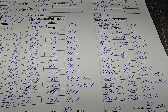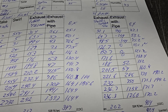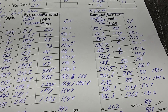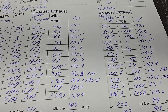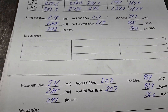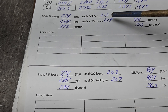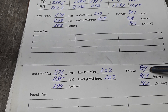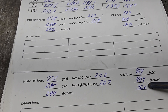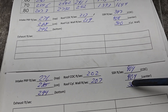The swirl here is actually a bit lower than I'd like to see it. Not much I can do about it — that's the intake as the intake. That intake is flowing at 287, so we're getting 236.7 out of it — not terrible, not as good as this side. Let's take a look at our air speeds. The pinch is almost identical, the roof is a little bit slower on this one, but our short side is more efficient — we got 360 right here.